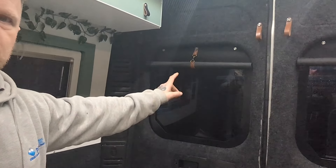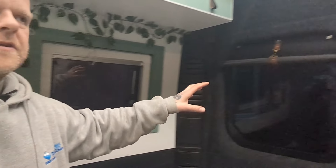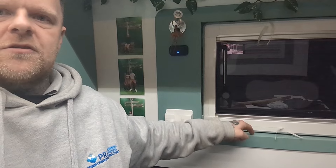What I did with the frames was make my first one as a template — I used the old bits of wood that came off the panels, cut one to size, and was then able to replicate it for all four. Same with the box frame around the window — I made sure I had a template where I could fit the wood inside, screw it together, and know it was going to fit, rather than screwing it all together and finding it's too tight or too big. That just makes it a lot easier. That is the windows done — time-consuming with the frames, but worth it.